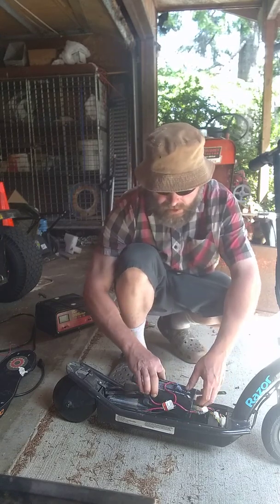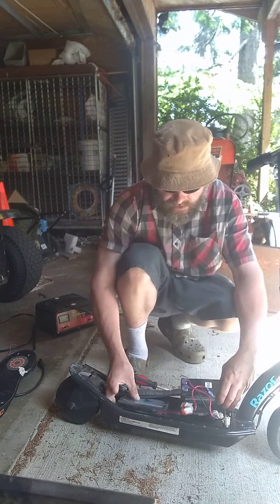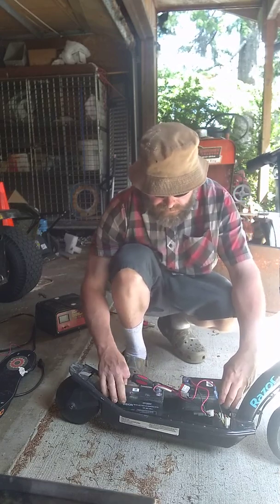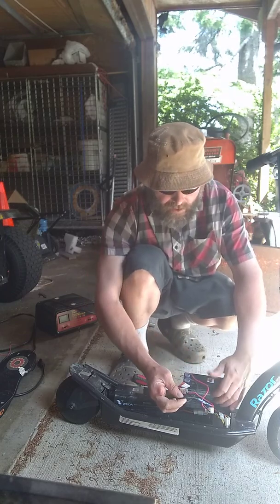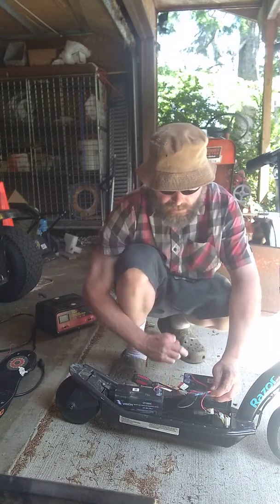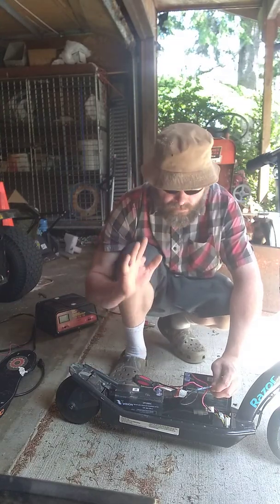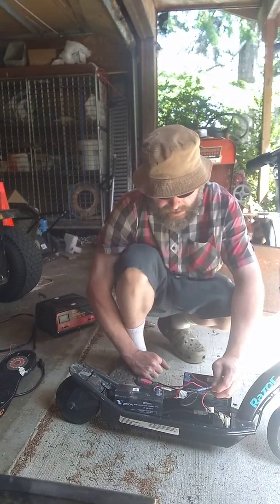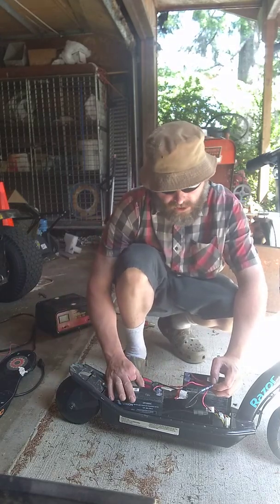The way they do that is they put one negative on one battery to the positive of another. I'm going to hold these up so hopefully you can see what I mean. I've gone ahead and just hooked them up so that it's easy for you to see what they have going on here. This is very important — the most important thing about charging these batteries is you're going to have to get these off 24 volts, get them down to 12 volts so you can use your car charger.